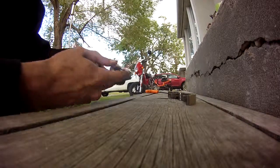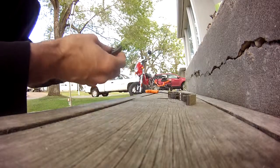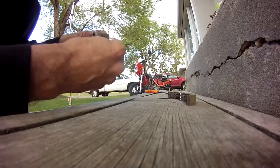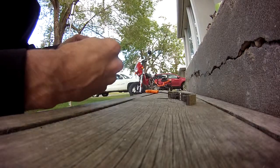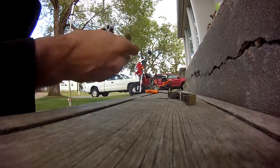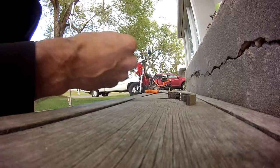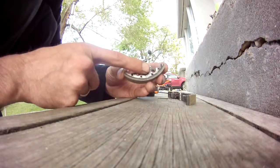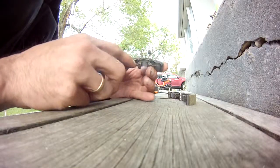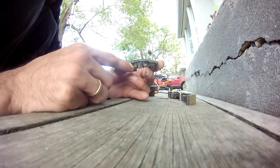If I crank down this back plate, it's going to go down just a hair more, and it's going to get tighter. So, I've got 2 options. I can thin out the back plate a little bit. I'd do it with sandpaper. I wouldn't be doing it with anything else. Or I can just smooth out the pads there with some more sandpaper. Just enough, but you've got those pins there.